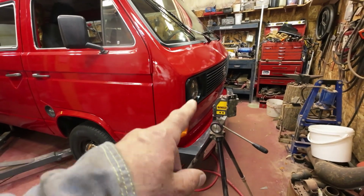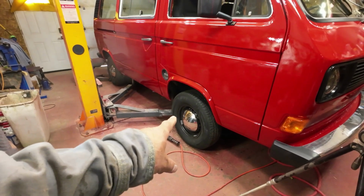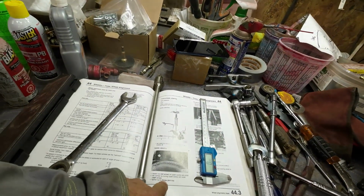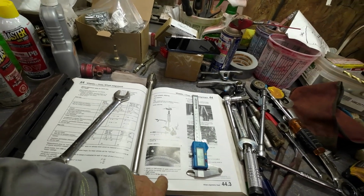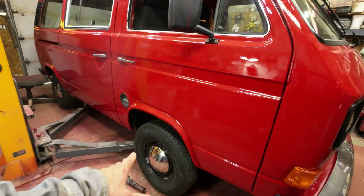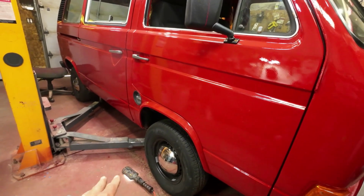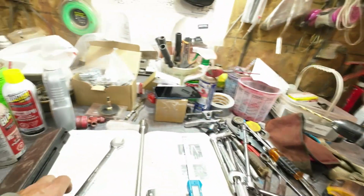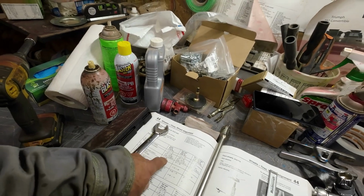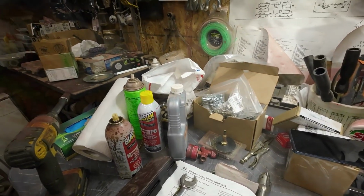Yes, there's the laser light thing, right? And now I've measured this. I torqued it up. It torques up to 75 newton meters or 54 foot-pounds, right? So I torqued it to 54 foot-pounds, checked it again, and the bottom is in by 2 millimeters, which was like its angular distance is plus or minus 30 minutes. So 2 millimeters, wait, I'll do the math and I'll tell you what that is.